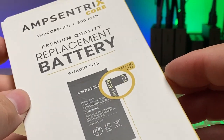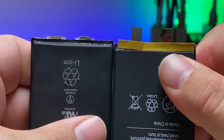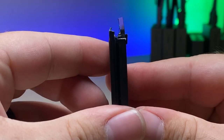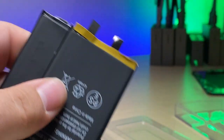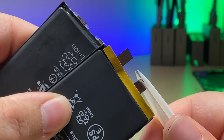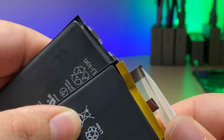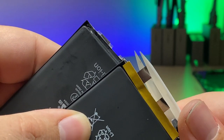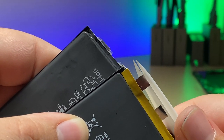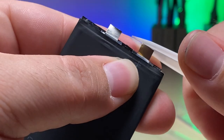Here I've got a replacement battery for the iPhone 11. Slide it out, and here we've got our new core with the leads that come off of it. You'll notice there's quite a difference in length between those leads. The difference plus a little bit of extra that we clipped off — I'm going to trim off of the new battery ends, which ends up being about right there. A little bit more — about an eighth of an inch. This one's a little thicker, takes a little bit more shear strength. There we go. I'm going to make that a little bit of a straighter cut.